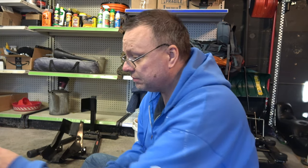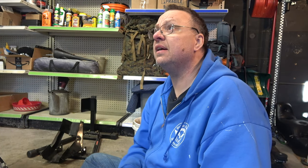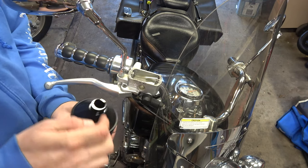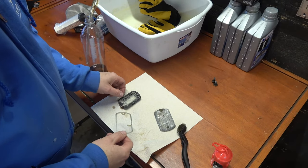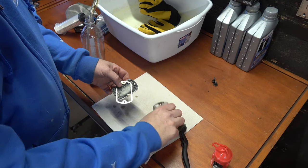So I'm going to leave it. Put the nipple cover back on there. Let's go check the fluid level of the actual reservoir. I'm actually thinking I'm going to take this stuff inside and wash it with soap and water — I know you don't want to introduce water into a brake system, but this stuff is just nasty. I do have a brass-bristled brush and I'm going to use that to scrub the metal parts and wash up the rubber. Let's go inside.